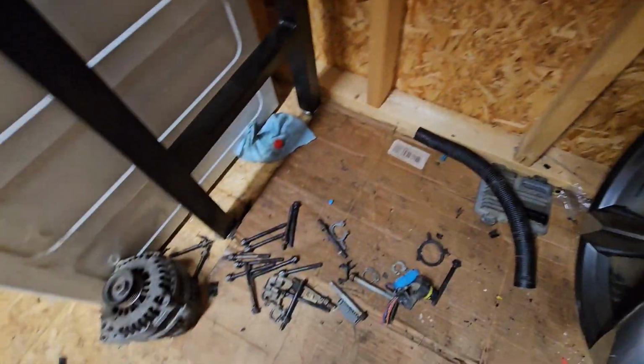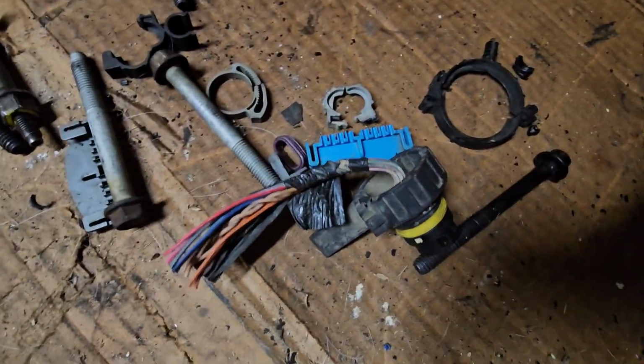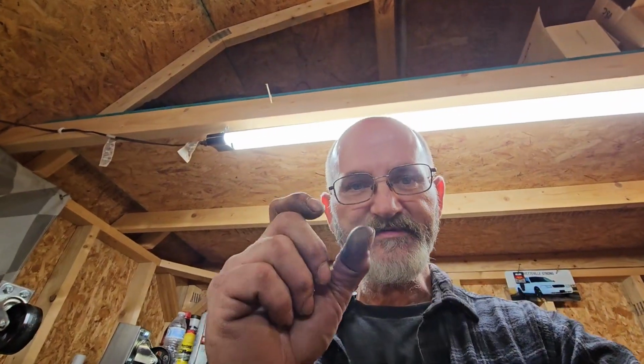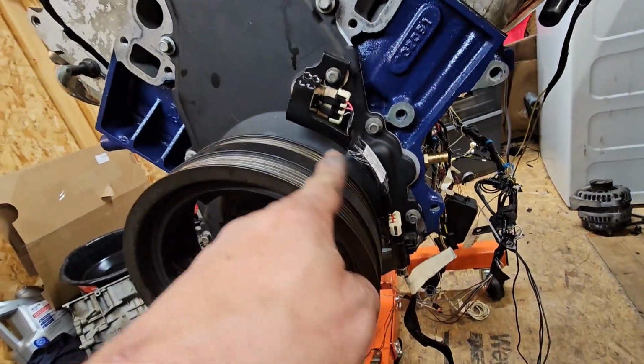I'm just like, well, I'll just butt connect it back together. So somewhere down here, there it is. I'll reconnect it. I'll butt connect it back in and all this stuff. I'm not soldering it because I don't care. But I'll put it back together. Butt connect it with the soldered butt connectors. You know, you just hit it with a little bit of heat and it melts the solder. That's a ticket, baby.